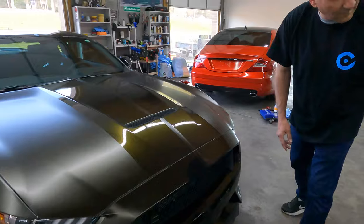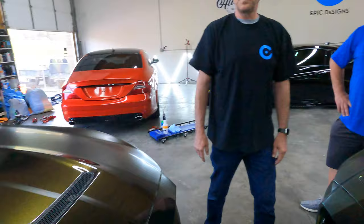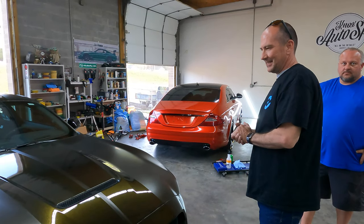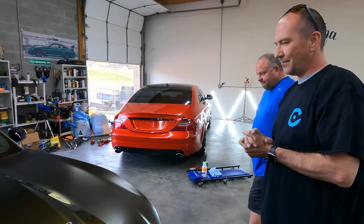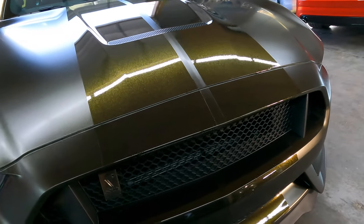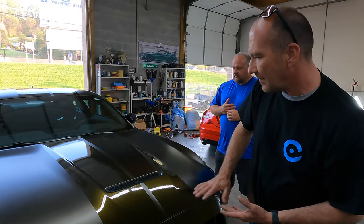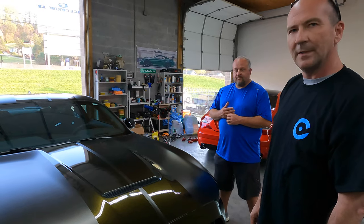This car has satin finish, obviously a little different - we've got gloss over satin. How did we achieve those glossy stripes? We came with that challenge and figured out what to do with it. We put it through a laminator, which we'd do with print material or anything else, and it's just a gloss laminate on top of the same satin Gold Dust 3M. It creates a gloss effect that makes the gold pop out and adds a whole other dimension to it.